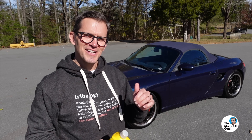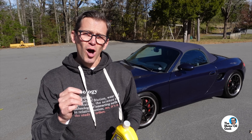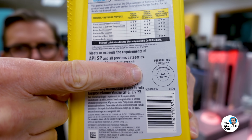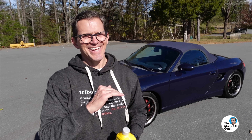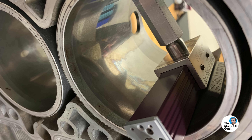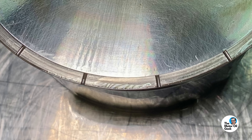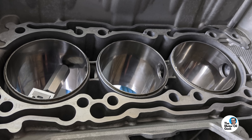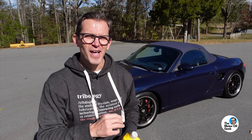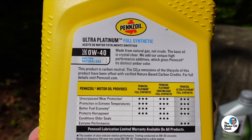And in this case, our application is the Wombat. We've been testing the Pennzoil Ultra Platinum in my Porsche Boxster, which calls for a 0W40 Porsche A40 spec oil. But this engine is not stock. Gone are the factory pistons, rings, and cylinders. We've replaced them with 2618 forged pistons, 0.9mm steel gas-ported rings, and sumo-bore coated cylinders. So there's no warranty on this modified engine, and we need an oil that can meet the needs of this unique engine. Because so far, none of the oils we've tried have been able to get the wear rate per 1,000 miles down to 5 parts per million or less.